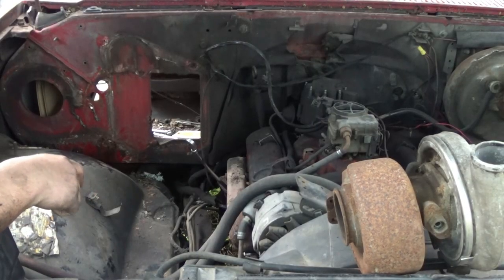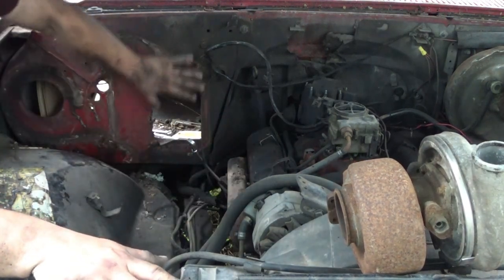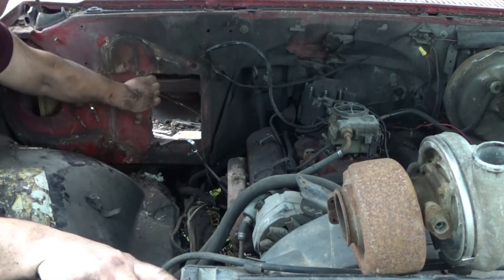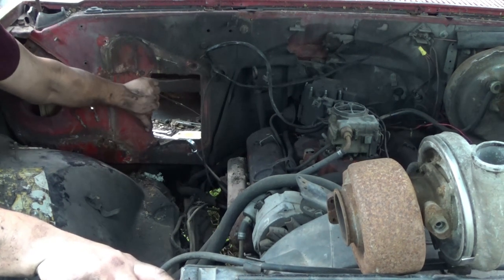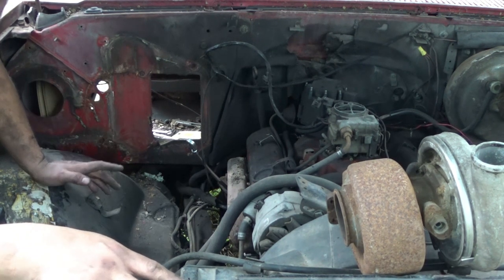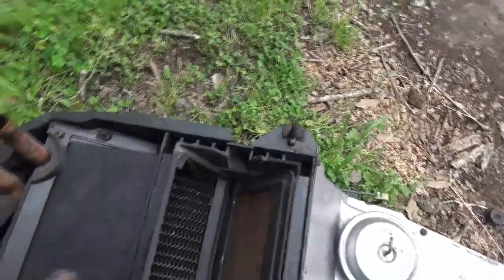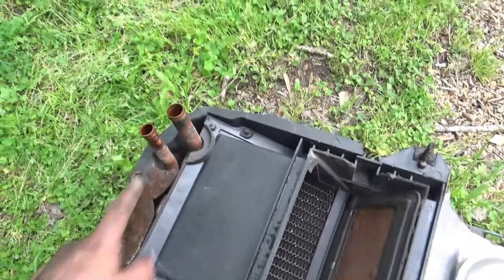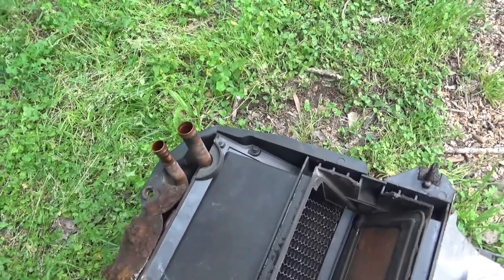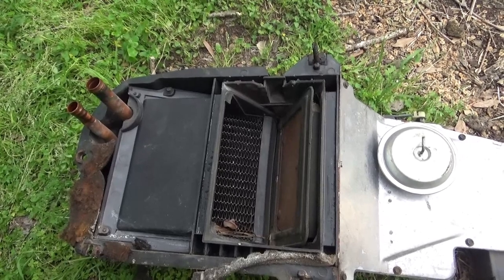The whole point of this was to lose a little bit of weight — that probably took off about 30 pounds or so. And now I have this big empty space where I can mount some stuff; just put a flat plate on it to seal that up. When you do this, you have to seal that up because you don't want all your smoke and stuff going in there. I know this video wasn't very complete, but a lot of the stuff was missing. If you wanted to change your heater core, it's right inside here — you just have a few bolts around the perimeter, and the heater core is right inside there. Be careful you don't squish yours — learn from my mistake. If anybody wants me to go further and take this apart, I will, but I'm just going to end this video right here. If you found this video helpful, please like and subscribe.